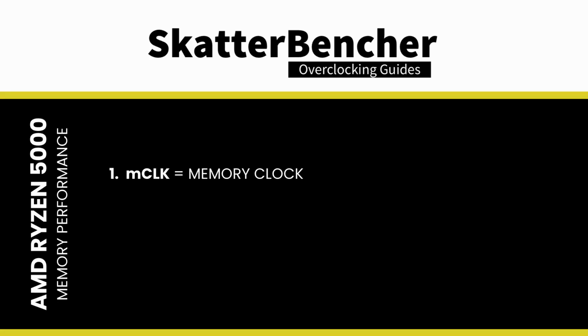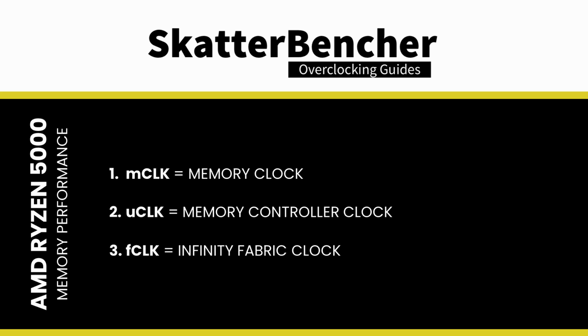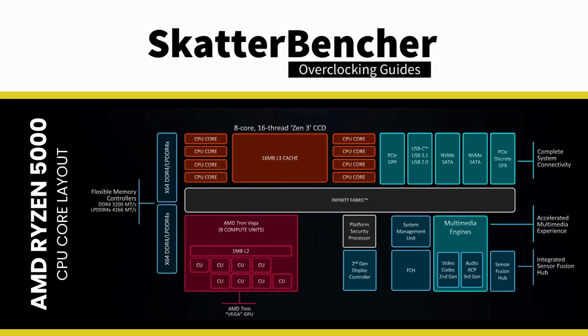To make a long story short, there are 3 relevant frequencies when it comes to system memory performance. M clock, or memory clock, is the frequency of your DDR4 memory. U clock, or memory controller clock, is the frequency of the integrated memory controllers. F clock, or fabric clock, is the frequency of the Infinity Fabric. When the CPU cores want to store data to or retrieve data from the system memory, it does this via the Infinity Fabric and the memory controllers.